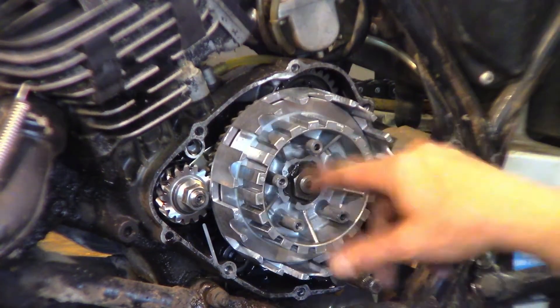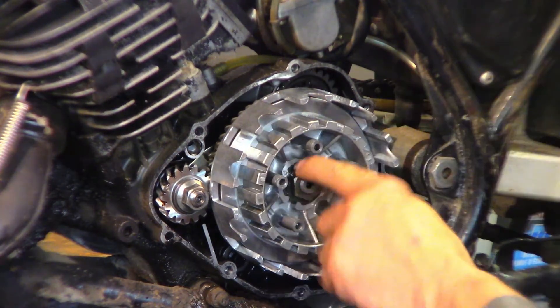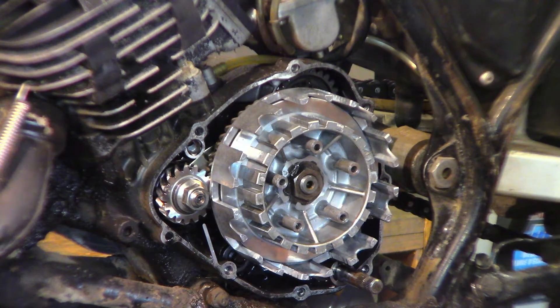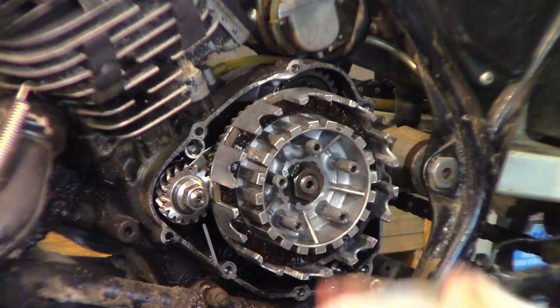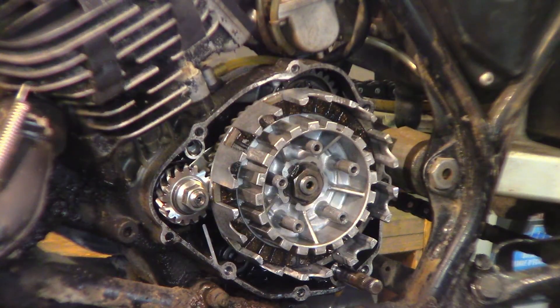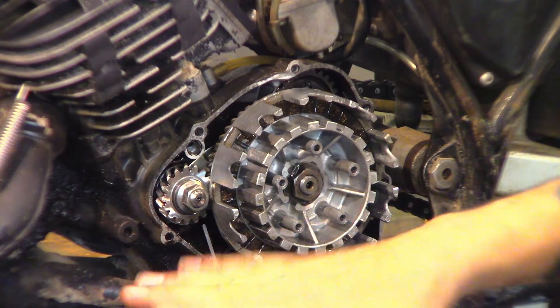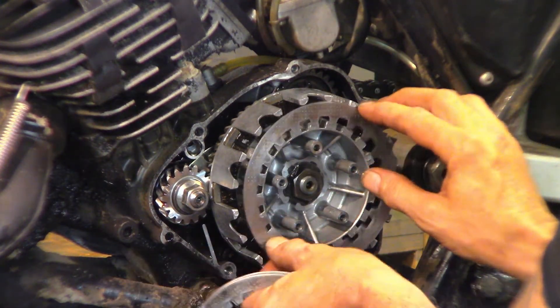I got the nut torqued down. I don't have the spec off the top of my head, but I got it about as tight as it was when I took it off. I locked the lock down — it's just a little sheet metal you got to bend over the flat of the nut so it doesn't come flying off. Let's get our clutch plates in there. I forgot to deglaze my steels yet. All my steel plates have been deglazed, shot with brake clean, blown with compressed air. They're old — probably 40 years old, probably original. Once I got them all stacked up, I just make sure none of them are warped — shuffle them like cards. You don't want any of them to act like a wave washer. Everything seems to be flat. They're deglazed good enough for what I do — I just ride on a dirt road and on grass.